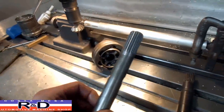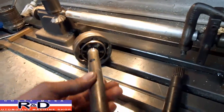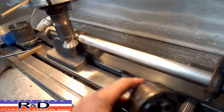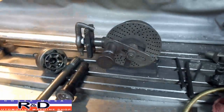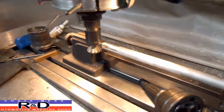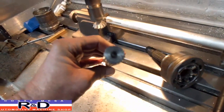I've already cut one so I can figure my depth out and it goes in there just fine. We've got a piece of aluminum here on the machine right now that we're going to show you how to do it. This is a pretty easy project if you have an index head, and you're going to need a 90-degree cutter because splines have a 90-degree included angle.